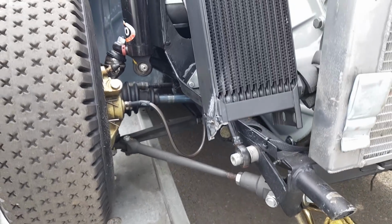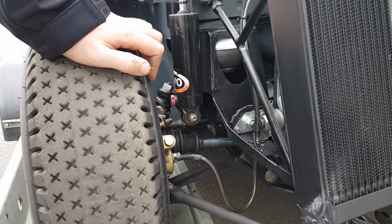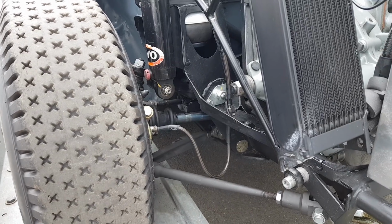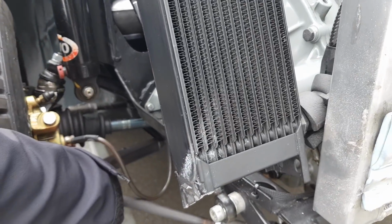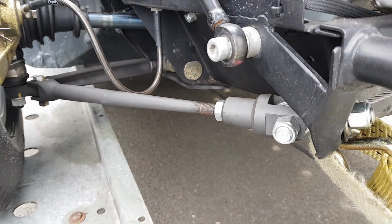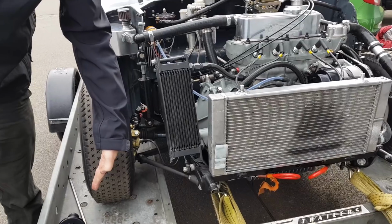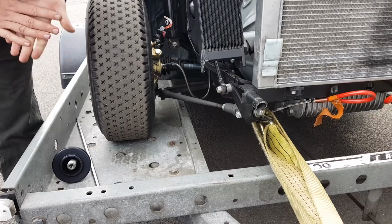So dampers you've got on there? These are steel body dampers, just Avo dampers that I found second hand from somewhere. Get you going. Ideally, quantums, but we'll work up to that maybe. And we've got adjustable lower arms down the bottom. On the Mini you've normally got a fixed bottom arm and a fixed tie rod. You can adjust the camber in situ down the bottom. We run about 1.5 degrees negative camber. Negative camber is when the wheel points out at the bottom and in at the top. When you go around the corner, the idea is to get as much rubber on the tarmac as possible.